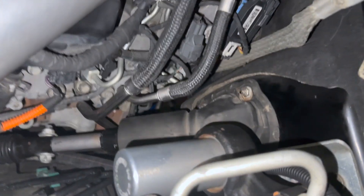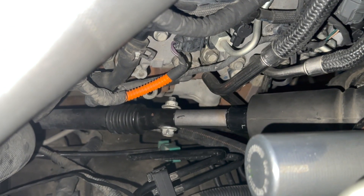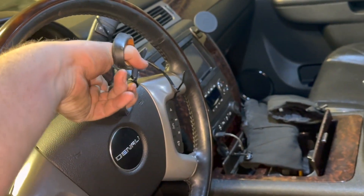I got everything back together — I put the two remaining bolts on the rubber housing and I'll order the third one I dropped. Torquing this down to 35 foot-pounds and the one underneath the dash to 37 foot-pounds. We just completed everything, torqued everything down — let's go ahead and test this out. Thank you so much for staying to the end. This wraps up part one of the series. In part two you'll see if this made a difference in the steering, and we also discovered more damage up front — lower control arm, wheel bearing, CV axles, and more. Make sure to like, subscribe, and leave your thoughts in the comments.